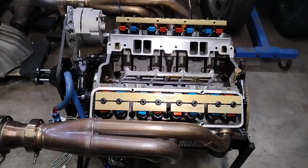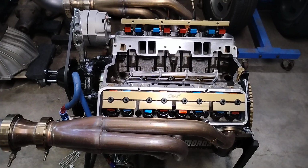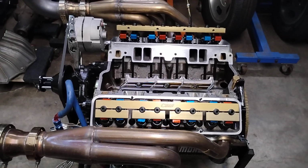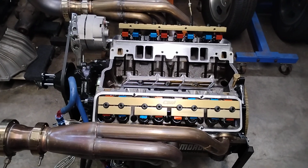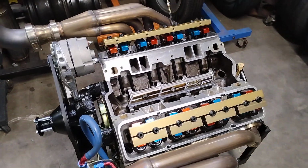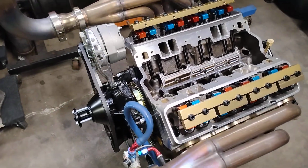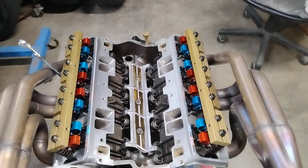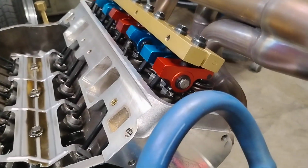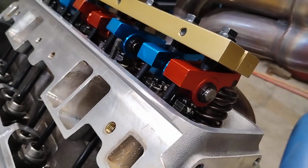Eventually, it's like header bolts. Put them in, you run them for a bit, and go back over them. They loosened up. You tighten them up again. Run them more. You go back over them, tighten them up again. Eventually, they hold their mud. But I just wanted to get some run time on this to make sure everything's okay. It is. That's the only funny thing I see, is them stud girdles moving down on me. Kinda odd.